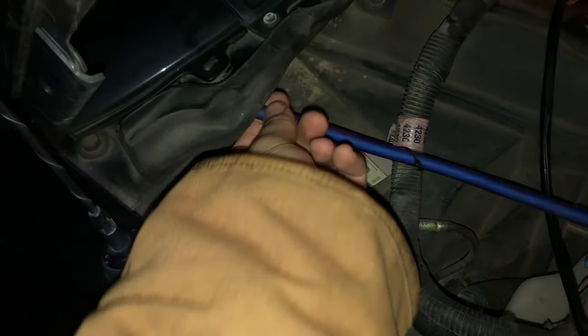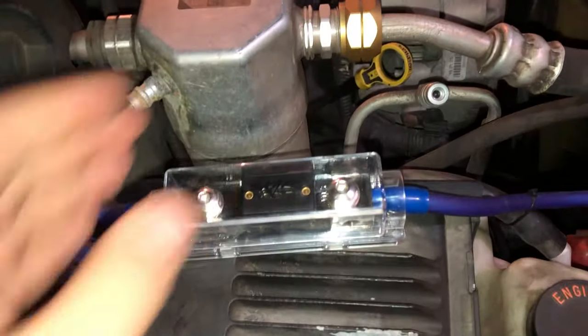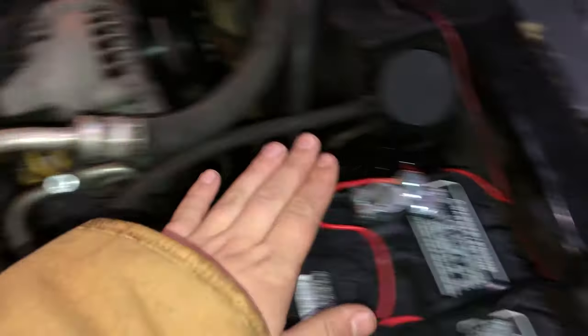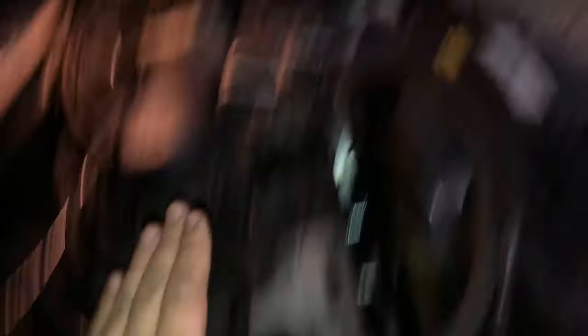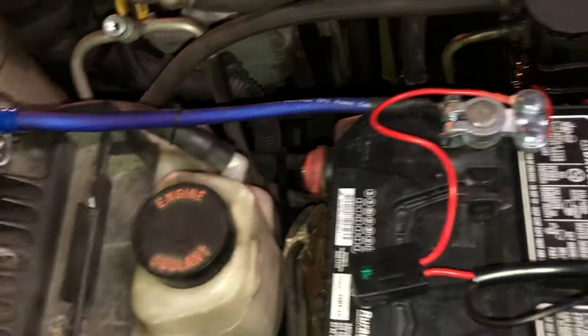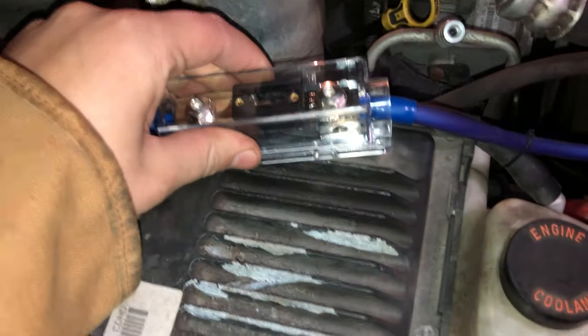You're going to run it through the door, up through this little plastic piece — it just pops right up, it's super simple. It's going to run underneath your rubber grommet for your hood so you're not smashing that wire. It's just going down on this rubber piece and around the wire, and then it's going to come over here. So you cut the wire here and leave enough room to go to your terminal, to your fuse.